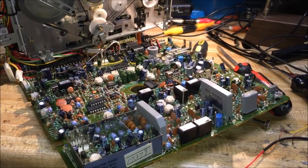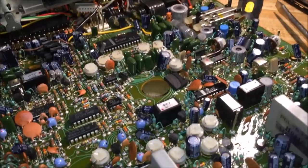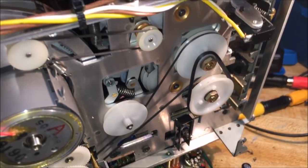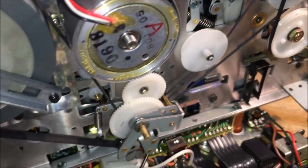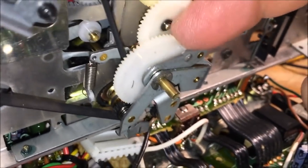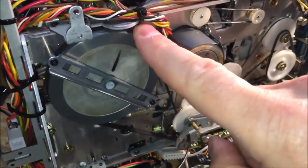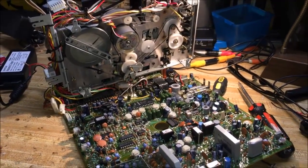Before we get into the transistor replacement, I thought we'd take a little side road here and take the motherboard off the chassis to let you see what's going on underneath. It's like Tron underneath here — like a network, a city of circuitry. There's the chassis separated from the main circuit board, and you can see all the pulleys and belts. This is the gear assembly I mentioned earlier and the little shaft it all fits on — you remove the C clip and the entire assembly comes off. This is the motor for the video head on the underside, and this is your flywheel for the capstan and the belt associated with it.